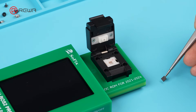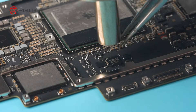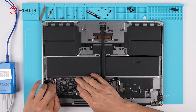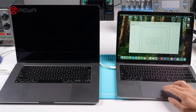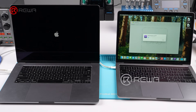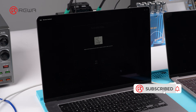Remove the chip and apply a bit of flux, then re-solder it back onto the board. Re-assemble the motherboard and reconnect all flex cables. Connect the faulty MacBook to another working MacBook and open Apple Configurator on the working MacBook. We can see the repaired device has entered DFU mode. Once the operating system installation completes, the repaired MacBook now shows the Apple logo and boots up successfully.